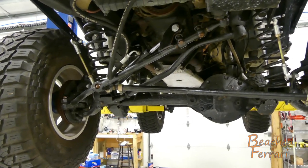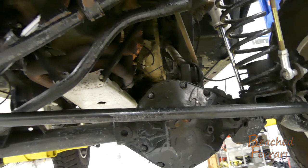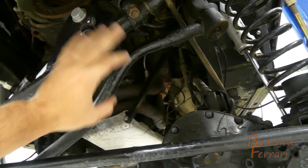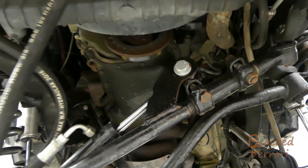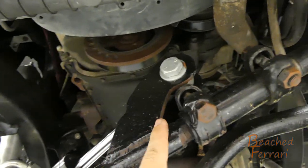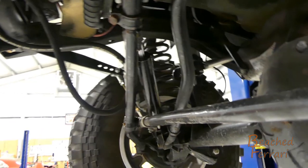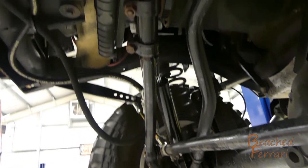This is an update after the first outing with the Redneck Ram. I went ahead and changed the mount — before I had it mounted on the tie rod, but I was getting some binding because of how little travel I had between the drag link and the track bar, and my mount was starting to hit there. So I've mounted it now off the drag link itself. I made a mount that pivots up and over so I can still use my adjustment to get my alignment dialed in. Now at full droop I'm not going to have any sort of binding — I've got plenty of clearance. Worked out a lot better.